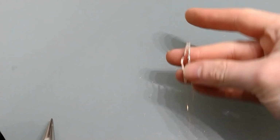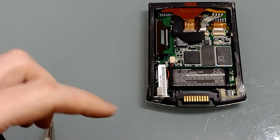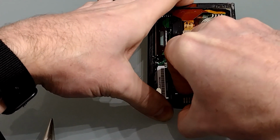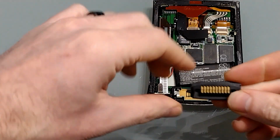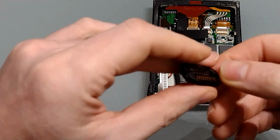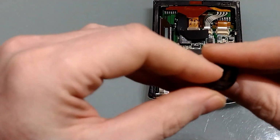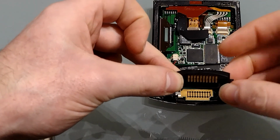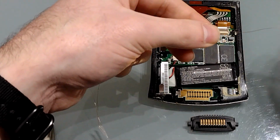So now we've done that part, we need to attach it to the Palm itself. On the bottom of the Palm 5 is the connector board, and it's actually separate from the rest of the body. A little bit of a wriggle, and you can pop it out. On the back, you'll see it's got springs which make the connection with the actual circuit board. So it's very easy for us to simply feed the wire around onto the correct pins before popping it back together. Once again, before we actually do that, we need to strip the lacquer from the wire that we're using.